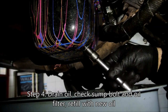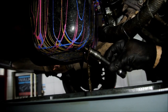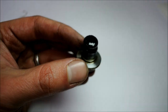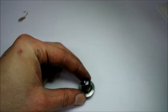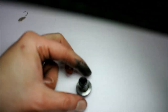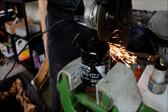Right after you have done this, drain the oil and use the opportunity to check how your engine is doing by looking at the magnetic sump plug you installed earlier. There will likely be some fuzz on your magnetic sump bolt, but don't let that concern you before you actually read the fuzz. Reading the fuzz is easy — all you have to do is smear it between your fingers. If you can't feel any hard particles, you are good. It should feel like a sort of cream or grey grease — you must not feel anything hard.